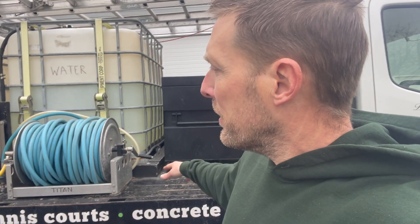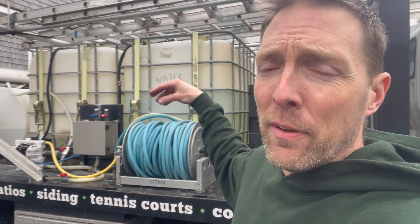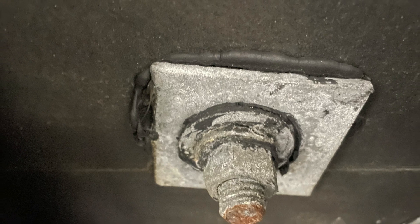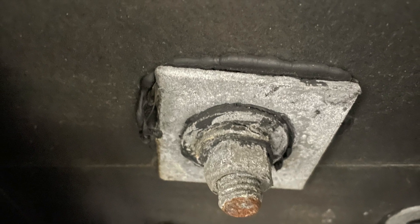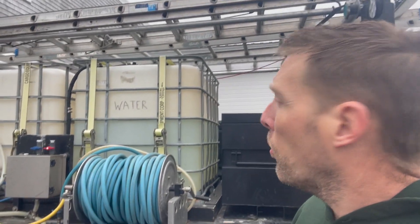Big steel cargo box from Home Depot — I can store everything I need in there. I've got room for spares, boots, gloves, pretty much anything I can think of. I specifically got the wood body on this flatbed — not aluminum, not steel — so I wouldn't have to weld if I wanted to mount equipment. Everything is through-bolted with galvanized hardware, and on the back side of everything is a backing plate, so basically the truck's got to fall apart for anything to fall off.